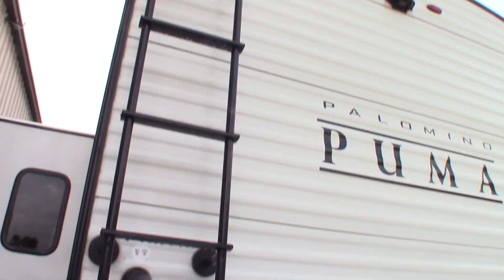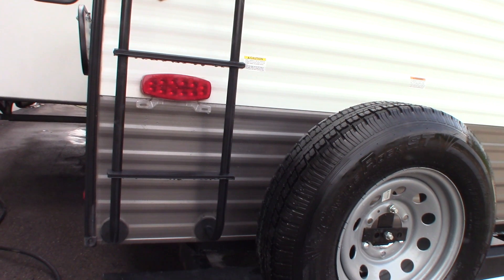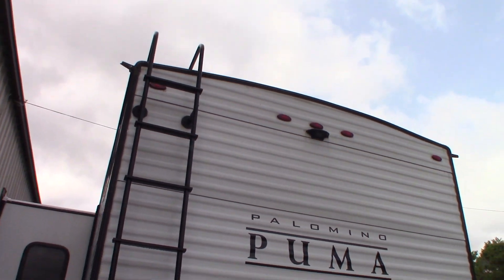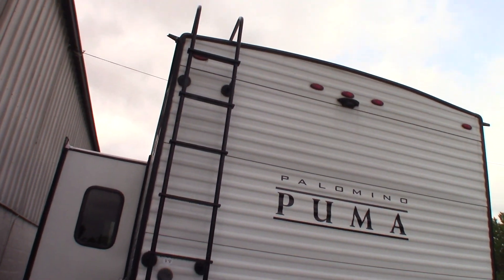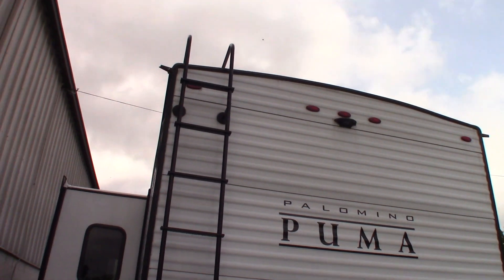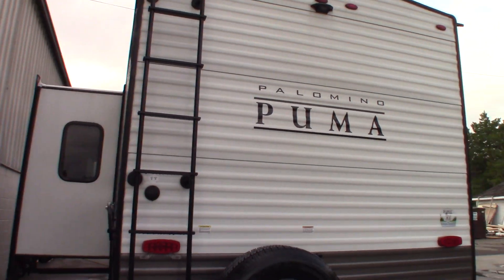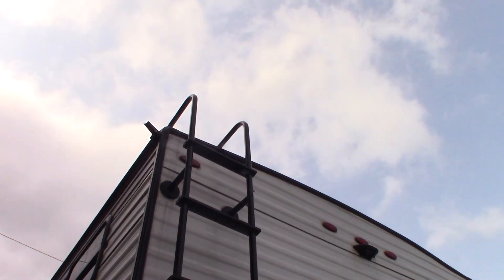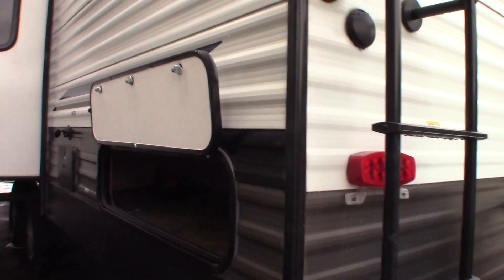You have a ladder, which makes accessing the roof really easy. The manufacturer states you should inspect the roof every 60 days or so. You want to go up there and make sure there's no damage to the roofing material or roofing attachments — no damage from low branches or road debris. Make sure all the sealant looks good, no cracking or separation where water can get through. It should be part of your regular maintenance.